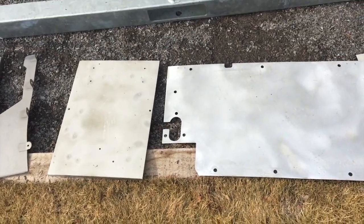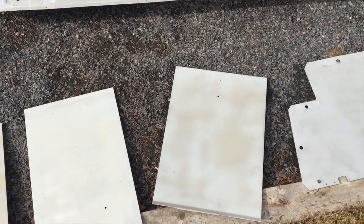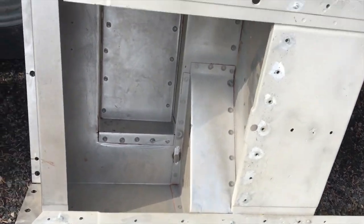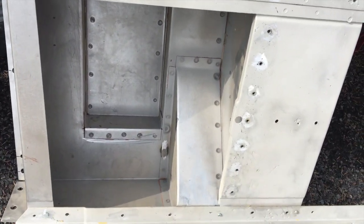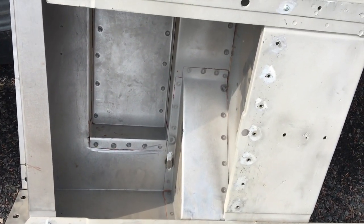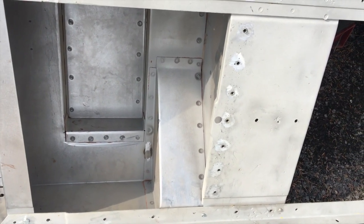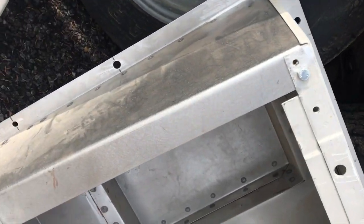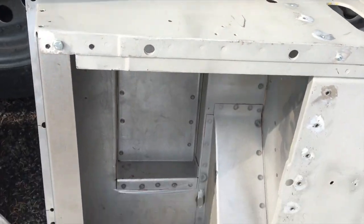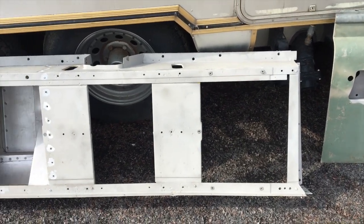We have some floors and seat box covers down here. This is the seat box — that intersection there, which can be a battery box on some models. Regardless, they all have the well for it. That is in steel and rusts badly, because it's open to the elements — water drains in there, sits there, and rusts it. It usually takes out the side too. So that has all been rebuilt. There's a lot of work that goes into rebuilding it, and it is now ready for coating.